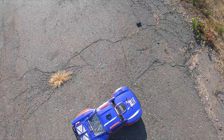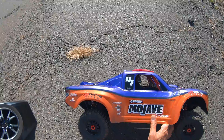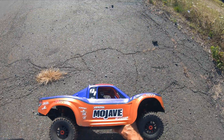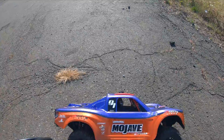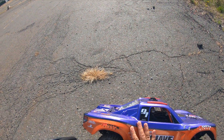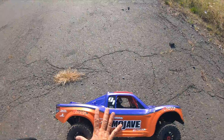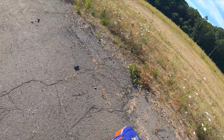We're gonna test this out — put CVDs on the rear and put new bearings in it. Let's see if it's gonna run any better and see if it still gets hot. Easy way to check if your bearings are bad after you run it: if these hubs are really hot, your bearings are bad, because the bearings are heating up. Let's see what we got going on.